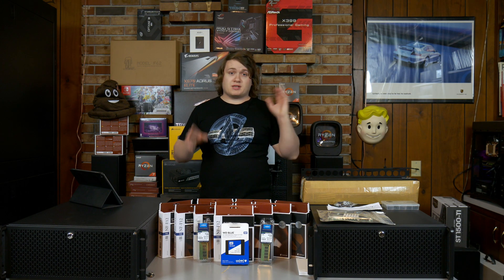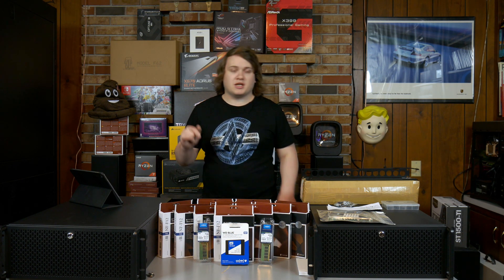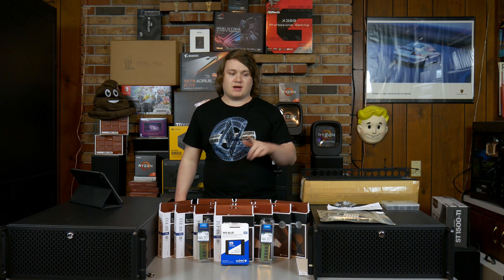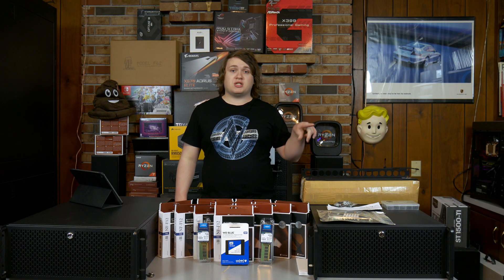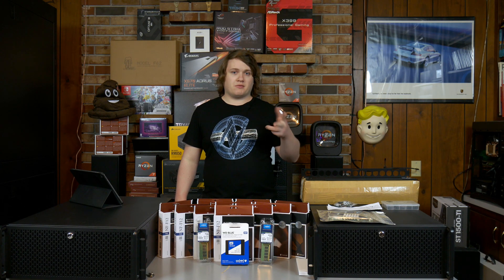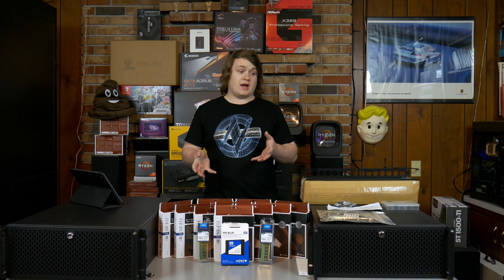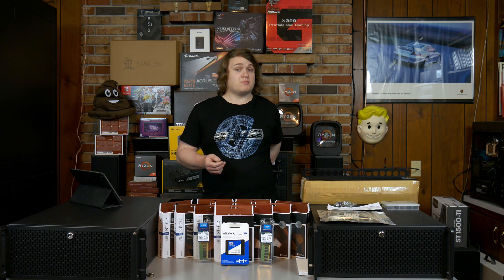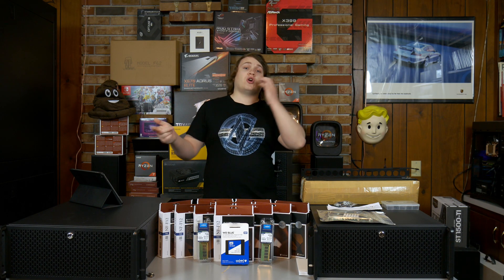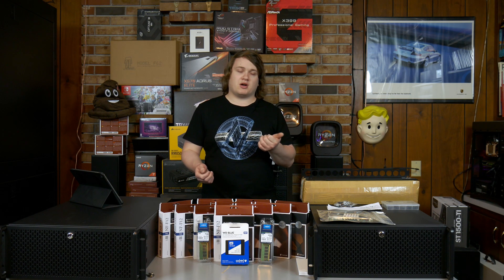Now really quick, to do a spec rundown of what's going to go in each of these systems - I've got a little bit of new specs to put in here. I've got another 16 gigs of ECC RAM to put in each, since each one's only running 16 right now. One of these is a Windows machine that's going to be converted to Proxmox virtual environment where you use ZFS for redundancy - ZFS file system uses a ton of RAM, so I'm going to need more RAM if I really want to spin up a lot of VMs. I'm bumping them to 32 each.